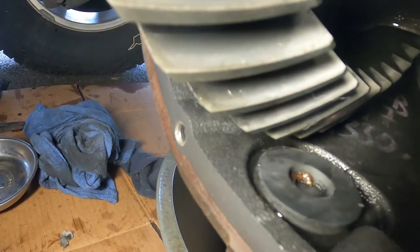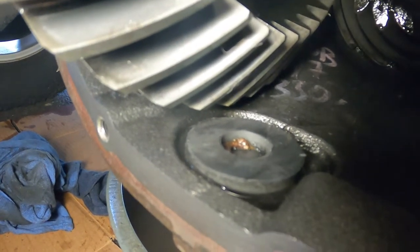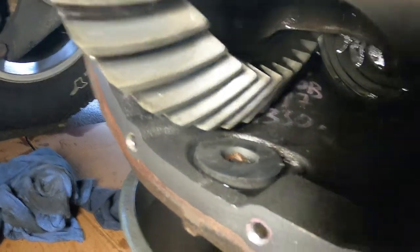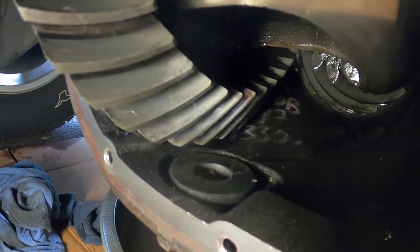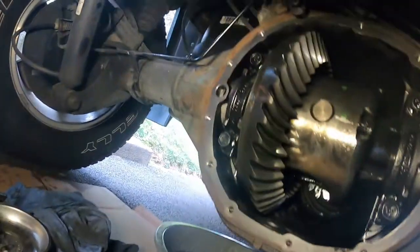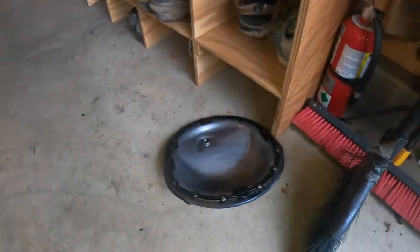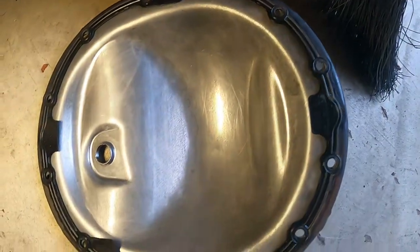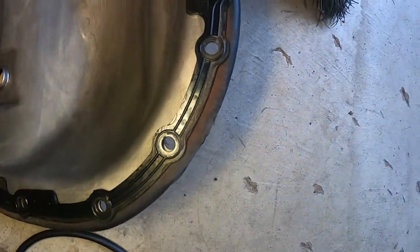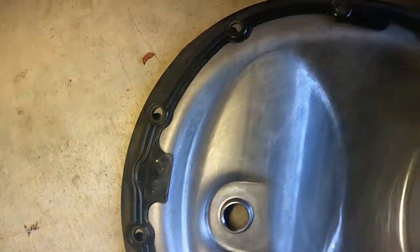All right, so that magnet would not come out — it looks like it's kind of glued in there with some RTV, some sort of sealant, you can see on the inside edge. So I just wiped it down with a bunch of different rags, sprayed it down with brake cleaner a bunch of times, tried to clean it as best I could. I don't want to pry it out and wind up breaking something. At this point we've got the whole outside cleaned up. I've also already cleaned up my cover — that looks quite a bit better — and I've cleaned up the fill plug. The gasket I just cleaned up; I'm going to reuse it. It is reusable, and I'd rather use that than sealant — sealant creates a big mess. So we'll put it back together.